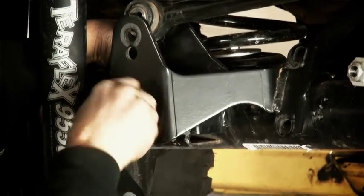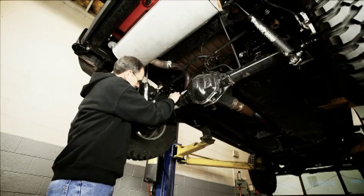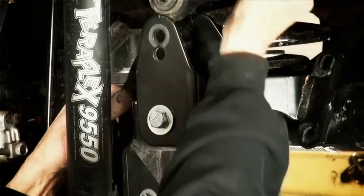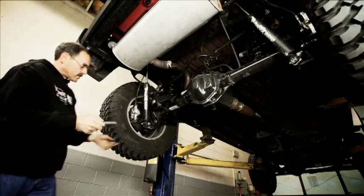Before we tighten anything up, we want to get all the bolts in it so that we can get it all into position, just started, so we're not going to be fighting ourselves. We'll put that bolt in last. This lower control arm bolt,